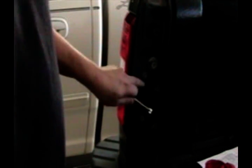I'm installing this on a 2004 Ford F-150 STX truck. So the first thing I've got to do is take the tail lights out — pretty simple, two bolts and it comes right out. The tail light comes out and you can just set it off to the side. The main reason you want to take it out is because you need access to the back of this panel.